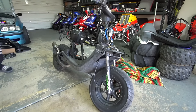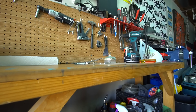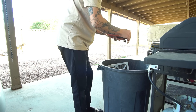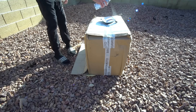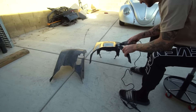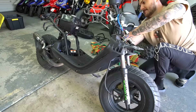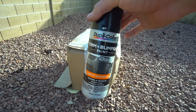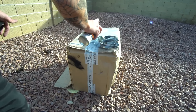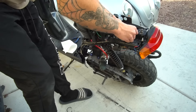I thought I could get away with using the faded underbelly but it looked really bad, so we had to take it back apart. Took the headlight bezel all apart, sanded it as smooth as possible — the paint on it wasn't actually too bad. Threw some primer on after rough sanding, put a couple coats of primer on letting it dry about 10 minutes between coats. We also matched the underbelly cut for the kickstand location — the new cut came out smoother and fit pretty good. Then I used my favorite trim and bumper paint, which gives a textured OEM look on plastic parts.